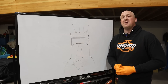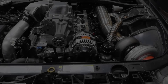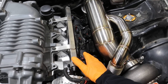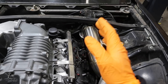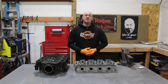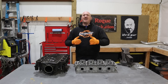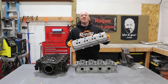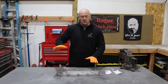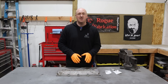Alright guys, I hope that clears up some things about the PCV system. Let's get back to the fab. Pretty much your standard Hemi valve covers are these composite, or basically plastic, style. I think they look really nice but unfortunately you can't modify them very easily. With the custom manifold I made for our supercharger system, I've effectively blocked those ports completely on both sides of the cylinder head, so I had to go with a set of these aluminum valve covers — the ones that came on this Magnum. They bolt directly up to any Hemi engine.